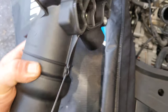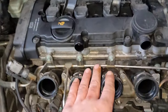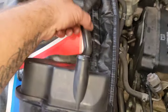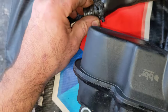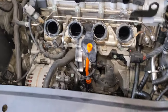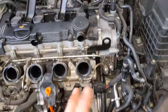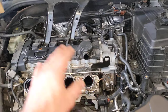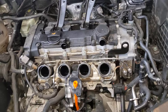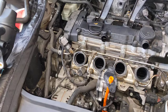Just a note when you're doing the job: this breather hose will usually be extremely brittle. Also this hose can crack on some, but not often. That hose doesn't give much room — it's very short — so check it out before you do the job.